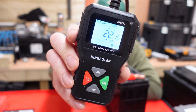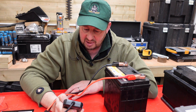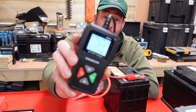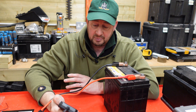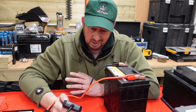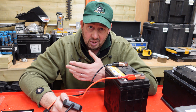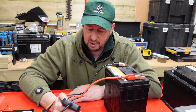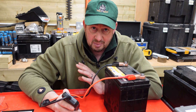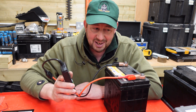Internal resistance is 22.15 — that's the ohm signal, possibly milliohms — and it's still saying poor. Voltage is 11.9 volts. If I was just doing this from a battery charger, I'd have thought 11.9 wasn't far off and left it on charge for a couple of hours. With a smart charger, they just tick along and turn off when the battery's had enough. I'd have thought that battery was pretty good, but it may not be as good as I thought and might let us down.